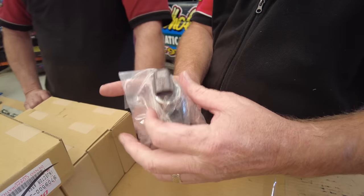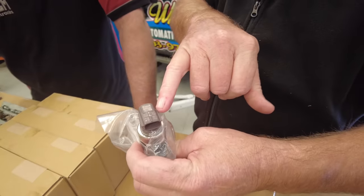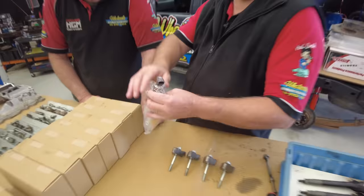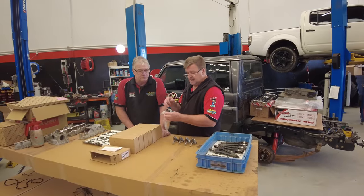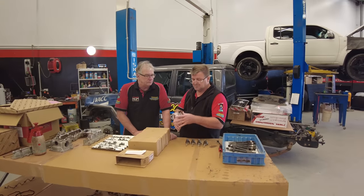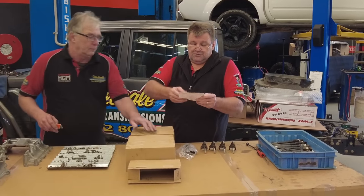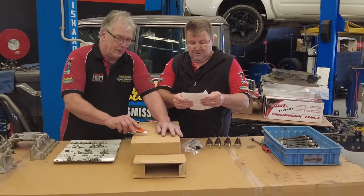One of the most important things when we put these new injectors in: we have to make sure we take a photo of the top of each individual injector and keep it as a reference. Because once we get the whole engine together, Andrew's going to come around, plug in his scanning machine, and program each individual one — they need to know which injector is in which spot. When all else fails, read the instructions. Have you read the instructions? No, it's not in English.